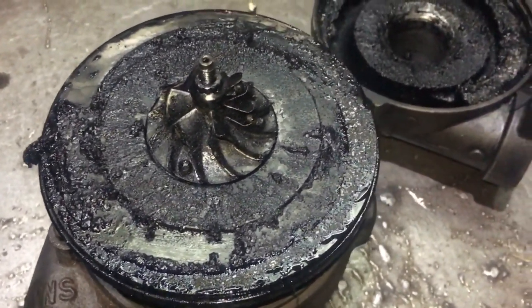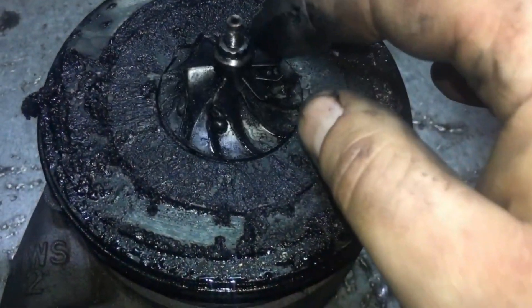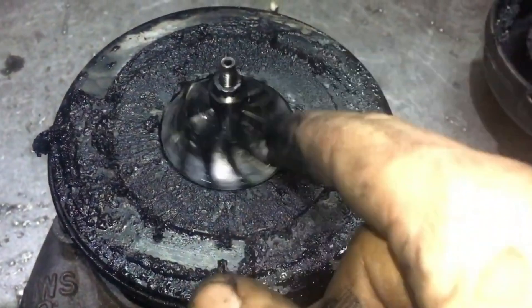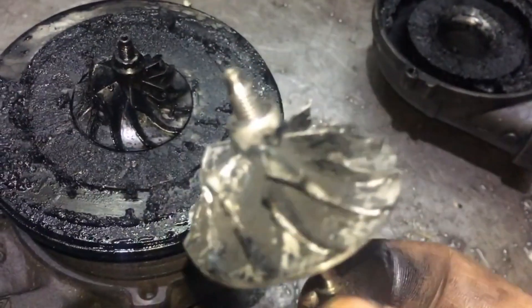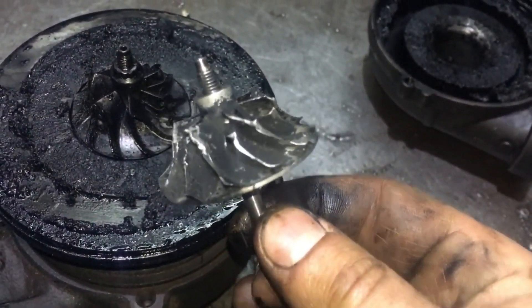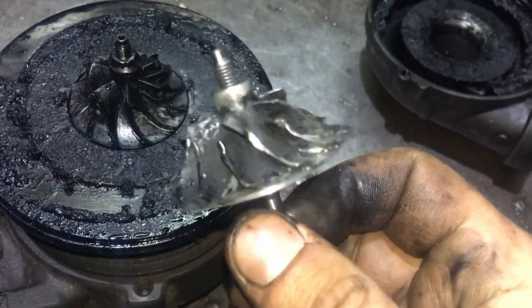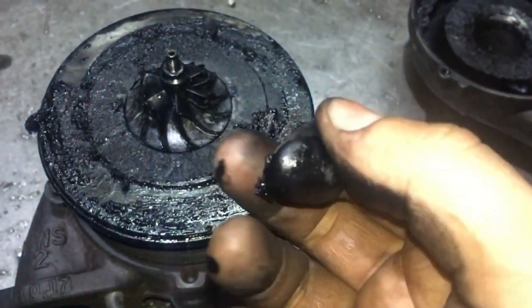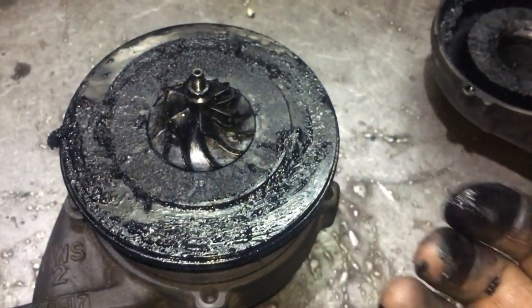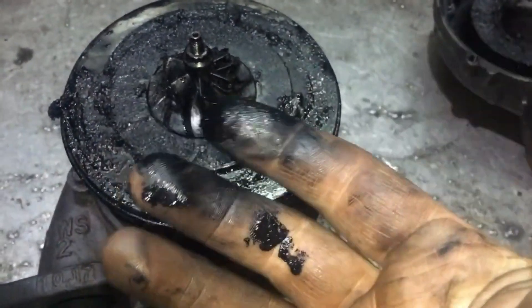Look, this is what it looks like. Here we can see in the photo the rotor of the compressor section. This is exactly that element — already destroyed previously. All of this didn't come from nowhere; it came from sending additional exhaust gases into the manifold through EGR. All of that gets pushed together with the air and has to settle somewhere — and this is exactly how the entire intake system gets contaminated.